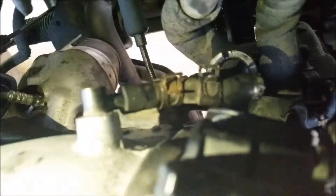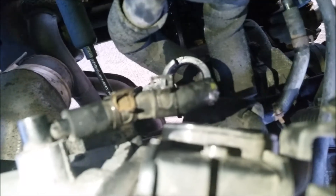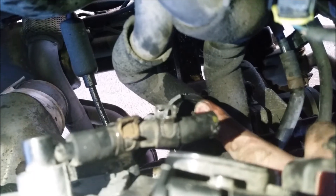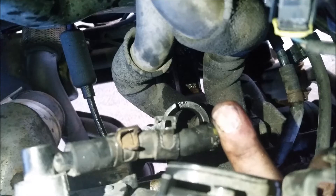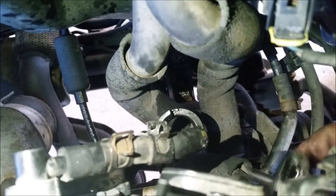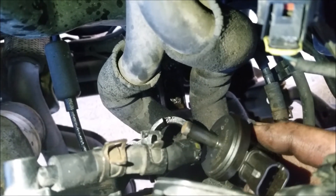I wasn't able to film and work at the same time — there's only about two or three inches of space for pliers and a screwdriver. There's a little three or four-inch fuel hose coming up from the purge valve, and the key is a little rubber O-ring adapter holder that you really have to pull on to free the purge valve. I'm pointing to it right there. Move the two clamps into the middle of the hose, then pull on the purge valve and that end pops right out. The top connection by the intake is the real challenge — there's absolutely no room.